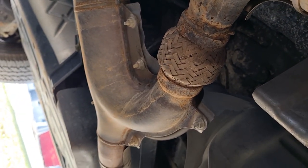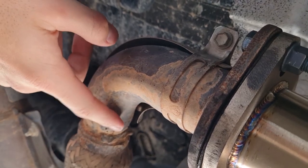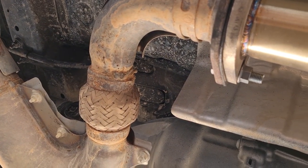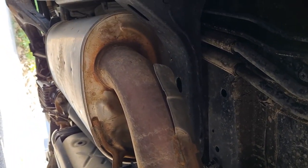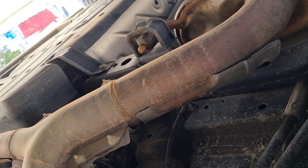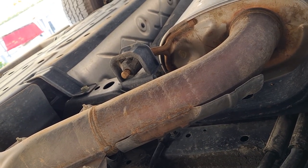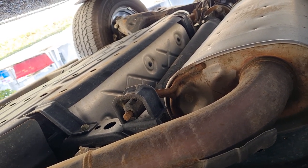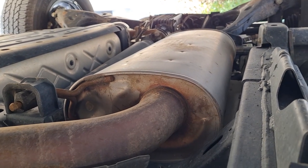I have to do something about this restriction here — it's meant to breathe through this tiny little bend which looks like 2 inches of steel, then moves into this massive 3 inch section that goes into the muffler. It would be pretty good to have that sorted and have the car sounding a heap more cranky. I'm going to do the same thing that Ruben did with his Y62 and have the exhaust dump out the side just behind the passenger door. So we'll figure out a way to do that.